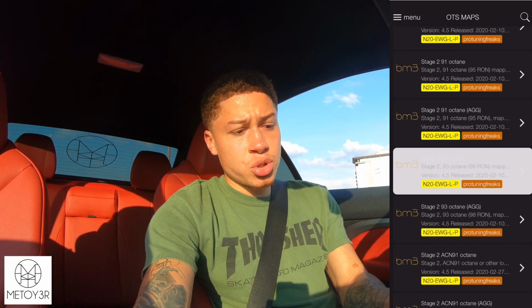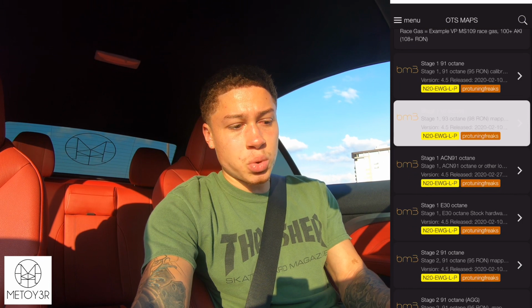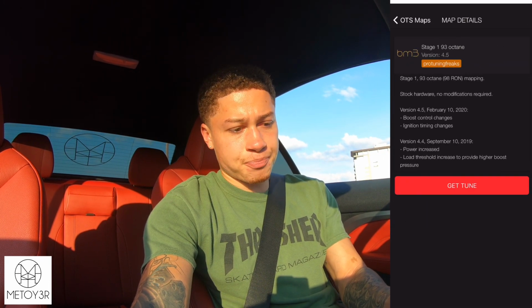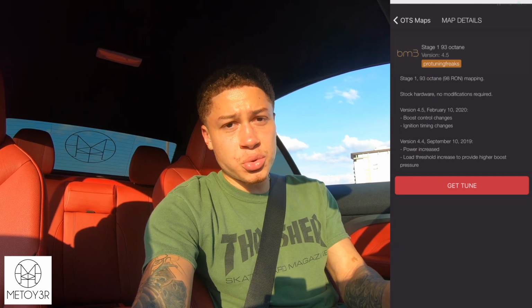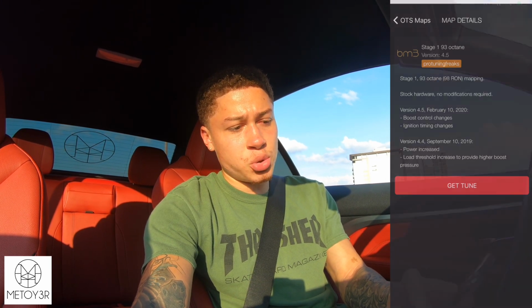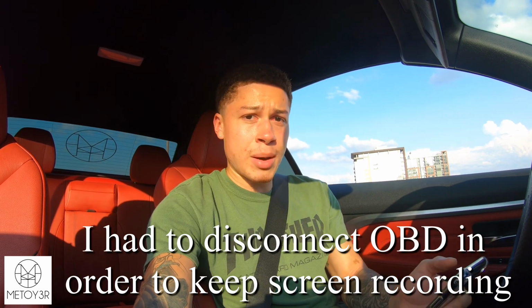So what you're gonna do is select the map that you want to flash. In my case, I'm gonna go stage 1 93 octane. So you select that, and I already have it downloaded, but you're gonna want to click get tune. You'll see this red button and it says get tune. You're gonna click that. It'll download your map to your phone or your laptop, whatever you're using.